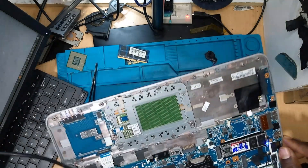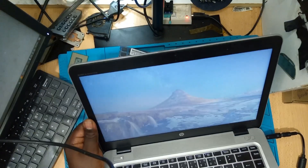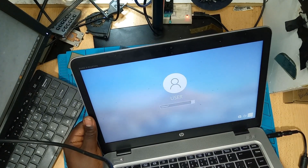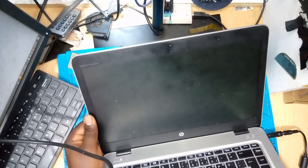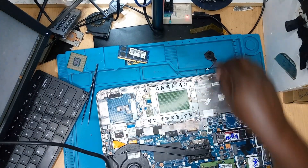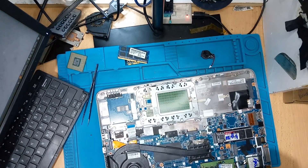You can see now the SSD is reading and the laptop is on! That tells us the RAM was the issue. The RAM slots were the issue — as we saw, there was dampness in that area. The RAM sticks were also not very clean. Also the BIOS chip — I saw some little dirt there and had to reflow the solder. But I think that was the main issue. Let me assemble the laptop and test it again.